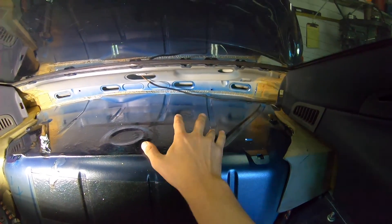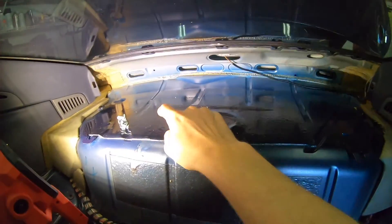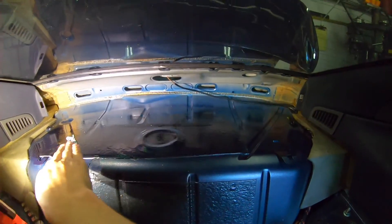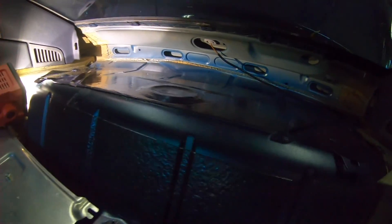I'm almost thinking instead of just having a bulge out piece right here, maybe do the whole thing - make a big window. That way you can access injectors and things like that on this side, and it will be symmetrical in the car. We'll just bump it out here and make a nice little panel bulge, an inch or so, come right up here and back down. Quick change of plans - we now have to go in with a torch and remove this sound deadening. There's just a square of sound deadening on there. Just torch it and scrape it - it's nasty, so a respirator and all that is definitely necessary. I want to get that all out of the way now. I'm not trying to cut through it with a blade because then it gets gross and super smoky.